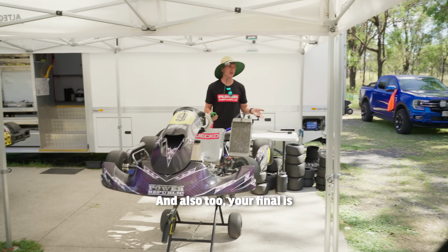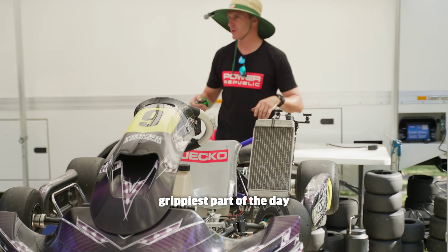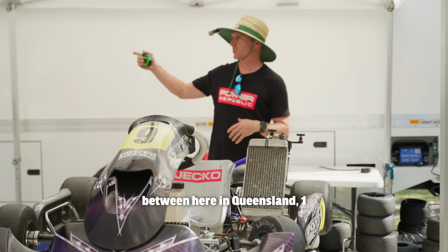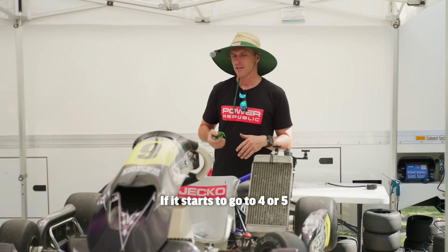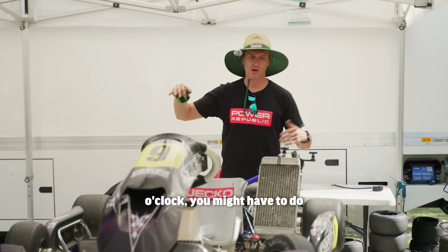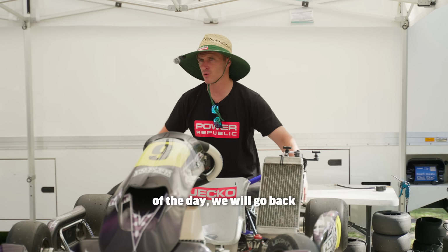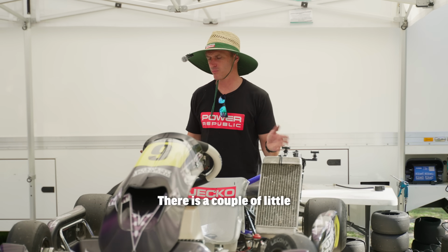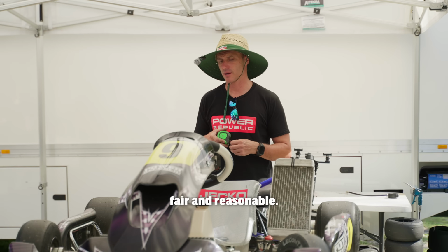And also too, your final is normally at the hottest, grippiest part of the day when you're going to get the most understeer, say, here in Queensland, between 1 and 3 o'clock in the afternoon. If it starts to go to 4 or 5 o'clock, you might have to do another change. Like if we're running shorties for the middle part of the day, we'll go back to the standards on the rear. There's a couple of little caveats there, but for the most part, that's what I find is very fair and reasonable.